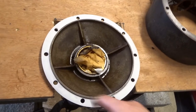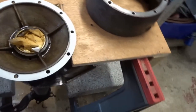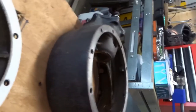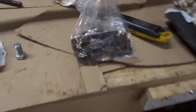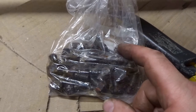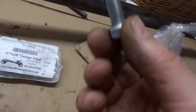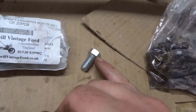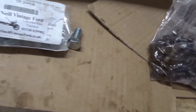Start with the thinnest gasket, which is white. There's a lip here so I'm going to put the gasket on there and then put the banjo onto it. I've got little marks - two marks there and two marks there which I did earlier so we make sure they match up. I'm going to do it up with maybe three bolts because this is going to be on and off a few times, and no sealant yet. These are the new diff bolts - apparently they're not ordinary bolts. They have a particularly fine thread and a kind of shoulder just there which helps stop oil leaks, and the head is quite deep.